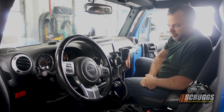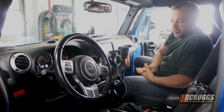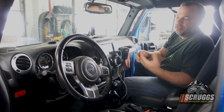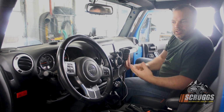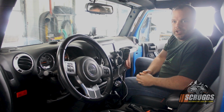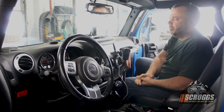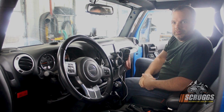And now, is this chipped or flashed? You're running any... No, the only thing I'm doing is the programmer that I have. It's a scan tool, and it allows me to reprogram for gearing. It's not VIN locked, and it'll basically do whatever the flash cal and the AEV ProCal does. I did for a while have the driving lights enabled, and then just turned them off because it was kind of a pain.